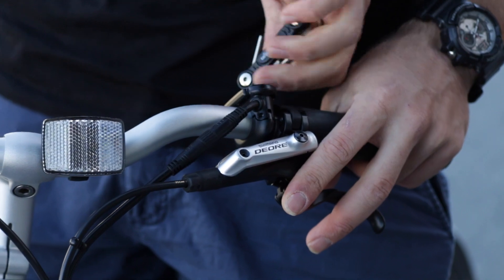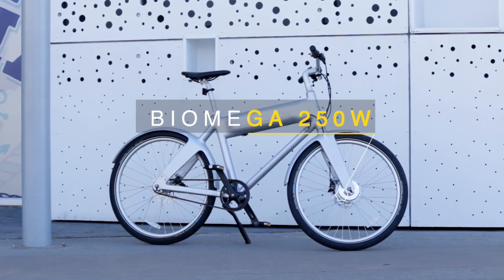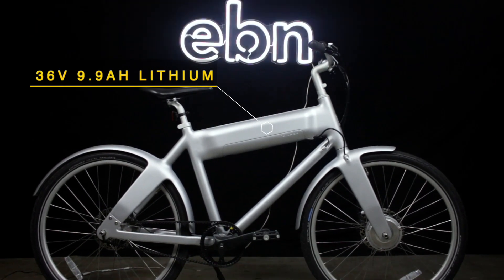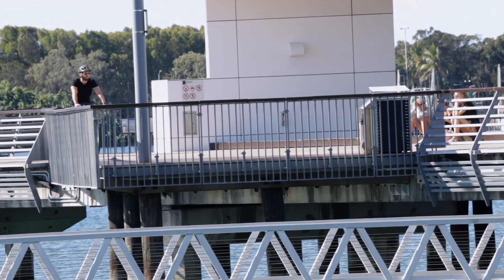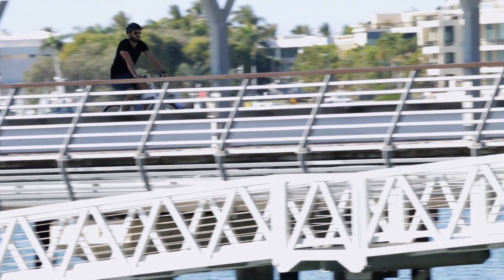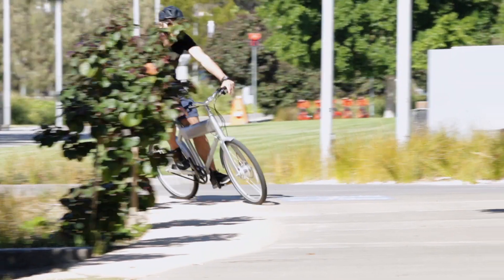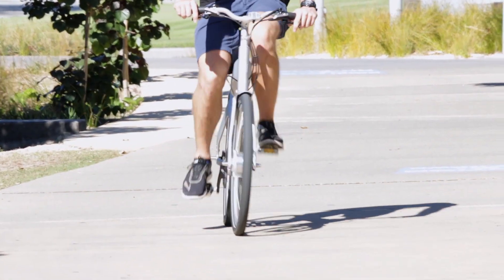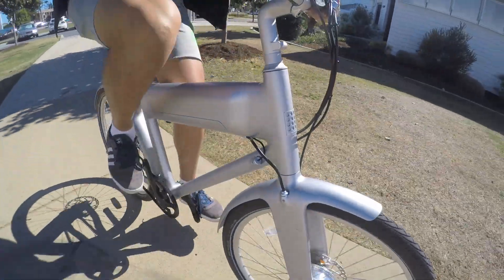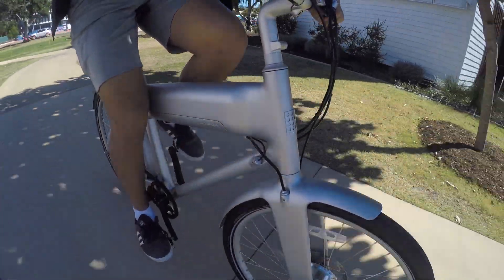Let's have a look at the spec sheet first. Like all other street legal e-bikes, the OKO is fitted with a 250W motor, housed in the front between the carbon fibre forks, and is powered by a 36V, 9.9Ah or 356Wh battery. This is a little on the smaller side compared to the average capacity of e-bikes nowadays, which range between 12 and 13Ah or 500Wh. Biomega estimates a range between 45 and 65km, which does seem a little bit generous. The general rule of thumb is that a 500Wh battery will get you about 2 hours of well-assisted riding, which at 25km/h will get you around 50km. So technically, the OKO should get around 35 to 40km of well-assisted riding — take these figures with a grain of salt, because it's almost impossible with so many factors playing a role.